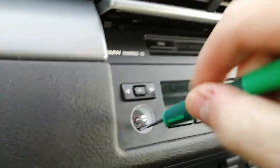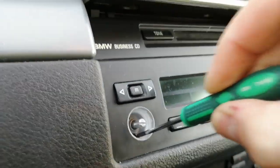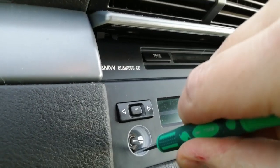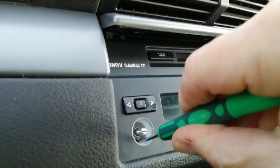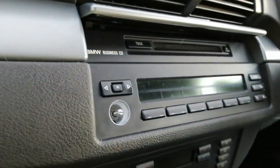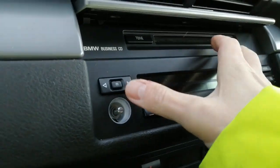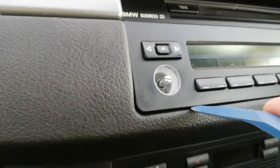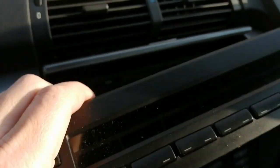Pop the TX10 in the hole and get it lined up — they are a bit awkward. Turn it basically a quarter of a turn; that's it, it'll lock, so it only moves that much. Quarter of a turn to the left and remove. That has now released the locking mechanism and you basically need to pull it forward. Best way to pull it forward is with a plastic leverage tool — don't use a screwdriver, you would damage your trim. Simply pull out.